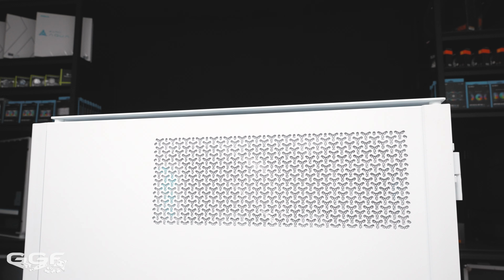I mentioned a little bit about the secondary ITX system. Don't want to mislead anyone where I said that you will have to go with the water block system only. You don't have to. A good option with a case like this being dual system, you can have a gaming setup on your main one. Of course, you can fit any size GPUs, but on the second one, you could have a dedicated streaming setup. So a lot of streamers run two systems so they can offload the stream onto a dedicated PC that doesn't affect their main gaming one. And that'll be perfect for an Elgato capture card, something like that, which will fit in the two slots. So don't think that you have to go with a water block GPU in this system if you're not using it for a gaming PC.